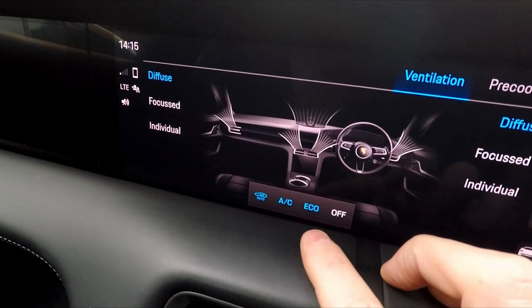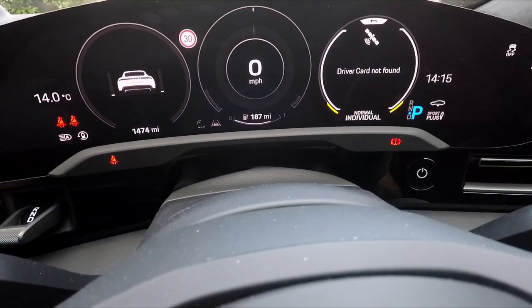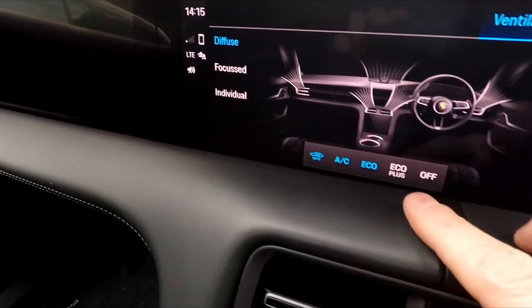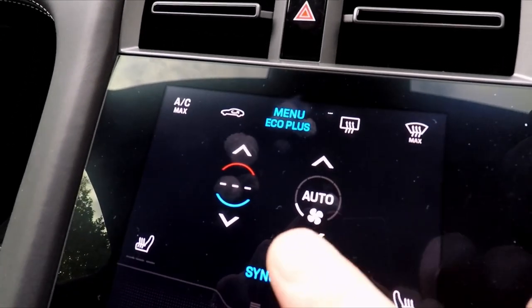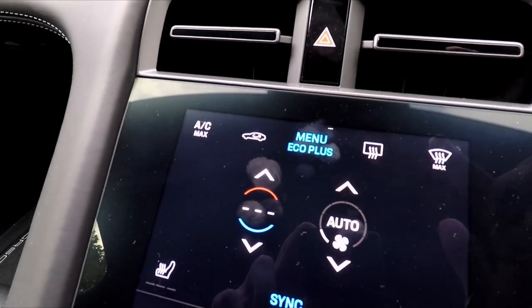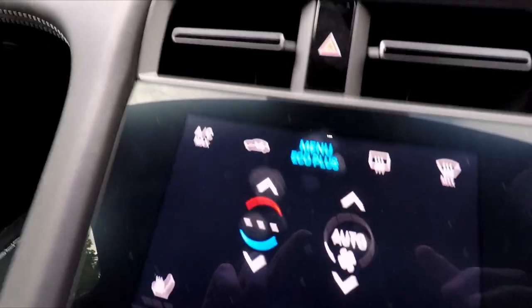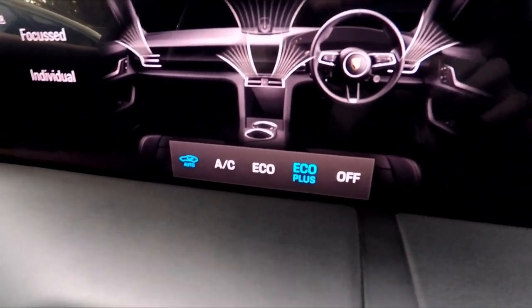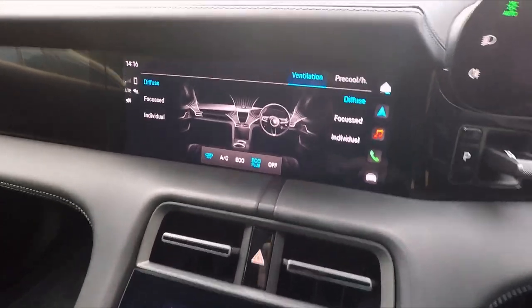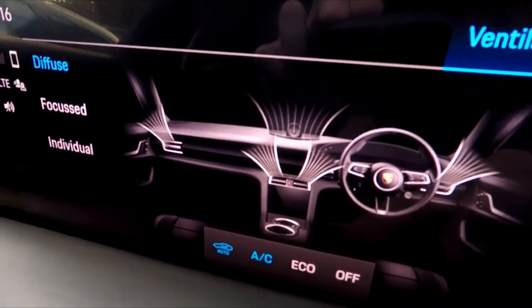Let's look at the different modes here for the vents. I should also add — if we go into range mode here, there is also an eco plus mode. You can see that we've got an eco plus mode that has appeared. And if I enable that, you can't actually set the temperature — it's preset in another menu via the home screen, the range mode settings. So have a look at that; it's on a previous video if you want to find out about that. It will also disable completely the compressor, so you're kind of just drawing air over the heater matrix — the AC matrix, the heat pump matrix — when you're moving along. You get that in range mode only, and it pretty much disables all the passenger cooling and just focuses on you. So let's go back into normal — we've lost the eco plus mode there.